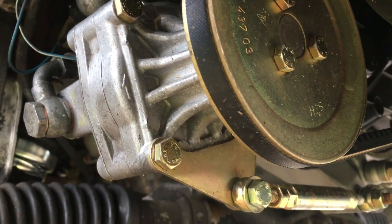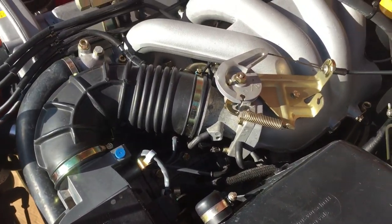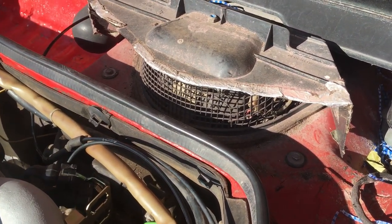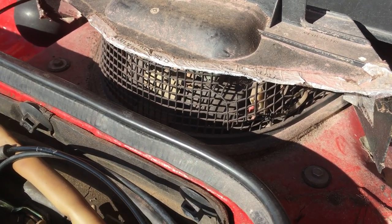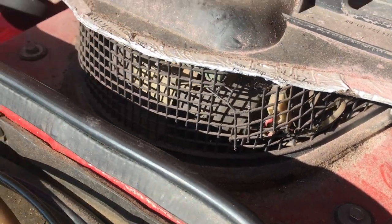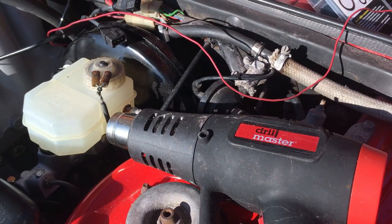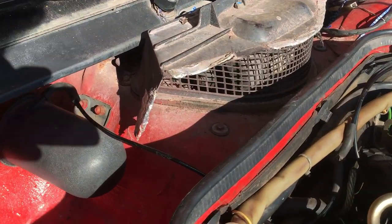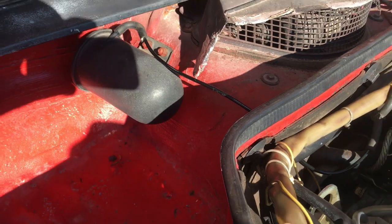Power steering pump's now on with new copper washers, the fluid's filled, and the belt's on. Here's a quick look at everything in the daylight. You can see that this engine looks fantastic. Today, what I need to do is clean up this area here — you can see there's a lot of sanding dust — but once I get it cleaned up, it should look pretty good. I'm going to be replacing this blower motor shroud here. I have one that I'm going to pull from a parts car, and it's in better condition. There's some goop that holds it on there, and it's freezing cold out here, so it's going to be tough to try and remove it. I've got my heat gun over here, and what I'm going to do is heat it up and I should be able to pull it right off. The first thing I'm going to do is get rid of all this dust — I don't want that getting down in there, so I need to get it all cleaned up before I remove that shroud.